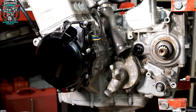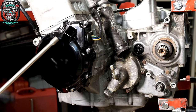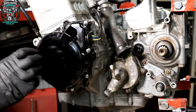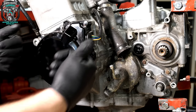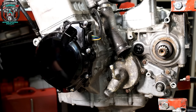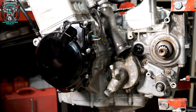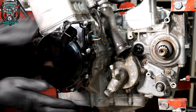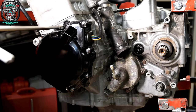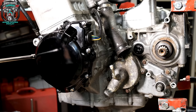Generator cover. The only thing we need to do is remove the generator cover. There are generally two types of design: designs where the stator coils are bolted to the cover and the flywheel is a dished-out affair — you put the cover on and the magnets do their thing. Then there's the other type, like some Yamahas and some R1s, where the generation coils are underneath the flywheel, so you need a flywheel puller to pull the flywheel off, because the coils are bolted to the lower crankcase. With this one, we should just be able to remove the cover and leave the flywheel on the end of the crankshaft.